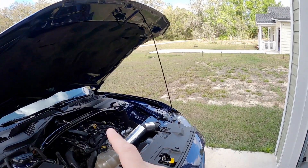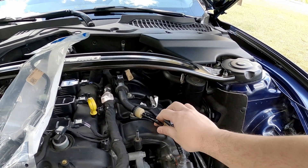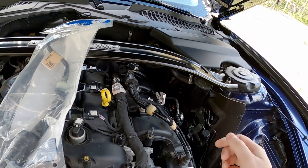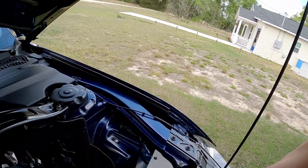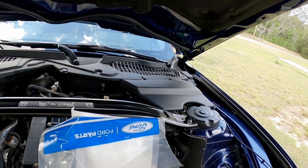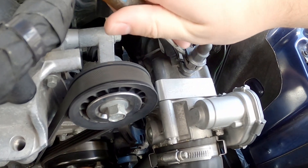While we're waiting to go pick up those parts, I do have something to take care of under the hood. Now, this was something I was going to make a whole video on, but that didn't happen — and it was supposed to happen a long time ago before I decided to put the car into a tree. And that is replacing this right here — the fuel vapor valve. Anyone who knows what this is knows that these are a problem, and yes, this has become a problem. Every time I would fill up gas, especially topping off a full tank, it would run weird and very rough. I would also very often get a huge whiff of just raw fuel. I guess there's always a possibility that problem is something else, but I still think it is related to the fuel vapor valve. So I ordered this a long time ago — genuine Ford part — and we're going to go ahead and slap this on real quick, hoping replacing this remedies a few of the problems I was having.